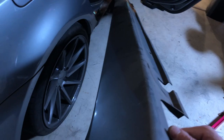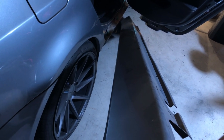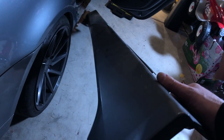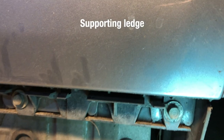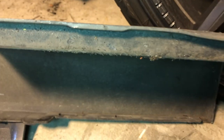And that's it! This is how you remove side skirts on the 5 Series — very easy. It's probably the easiest body part you can remove on a BMW 5 Series. I'm going to be selling these stock non-M side skirts — they're in excellent condition. For people who'd like to know what holds the side skirt at the front, this is the clip that goes on the fender and clips into these grooves on the side skirt. You don't have to worry about breaking anything — they're pretty sturdy.